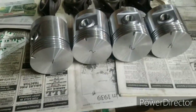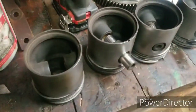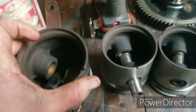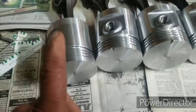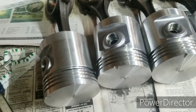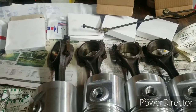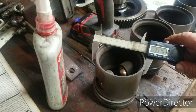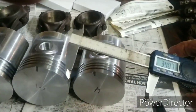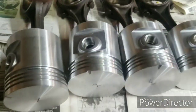It's Sunday, December 4th. I've been working on getting these old pistons off the rods. These are cast iron pistons with bronze bushings in them — there are the old pins. The kit came with aluminum pistons. These are overbore pistons; I think they're about three and three-eighths, and these are three and seven-sixteenths. Anyhow, they are overbore.